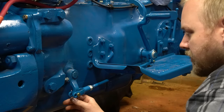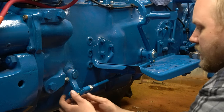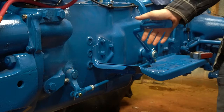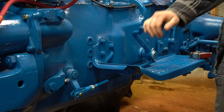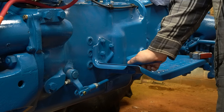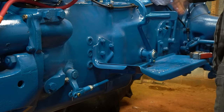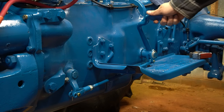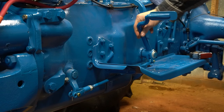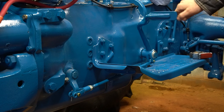I'm not going to bend the cotter pin yet, because to adjust everything you'll have to pull this out and turn the clevis since this rod will not spin now. There's the clutch and it does return. As you can see, there's no wiggle in this pedal - that's the slop that's in the linkage.